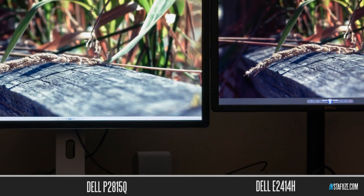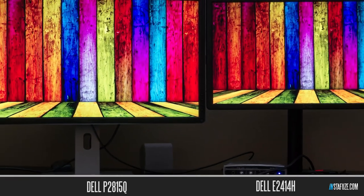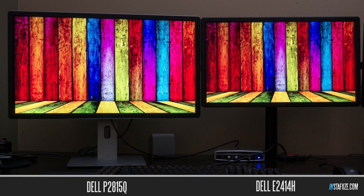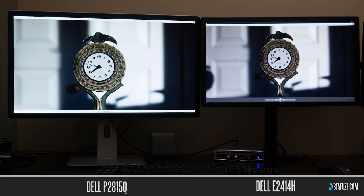In terms of overall image quality of the UHD panel, it is very good — color responsiveness, vibrancy, and overall image quality are pretty good and very similar to the 24-inch. The sharpness you get out of 4K certainly surpasses standard 1080p in terms of sharpness, and the color response is fairly good, though not as accurate as you'd want for printing or critical color analysis. You'd want to calibrate it, or invest in the UltraSharp series if you're a true professional — but overall, it's definitely not a bad photo and video editing monitor for most people.